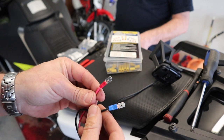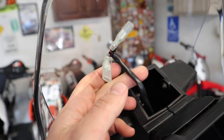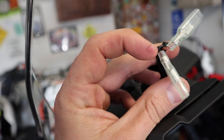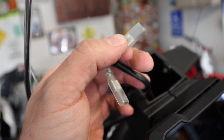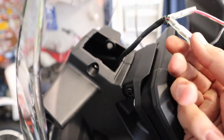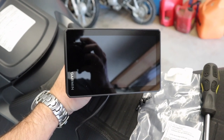There it is with the blades installed. Now we're going to get these plugged in up front so we can get power to the unit. The brown wire is our ground wire, while the black wire with a little bit of red on it is our power wire. On the Garmin unit we're going to plug the black wire into the brown wire and plug the red wire into the black-and-red wire. To reiterate: ground wire goes to the ground wire on the bike, which is brown; hot wire goes to the hot wire on the bike, which is black and red.